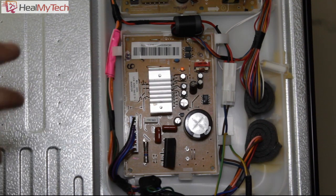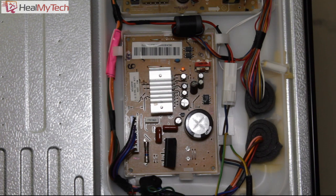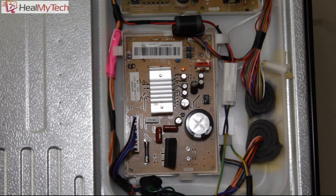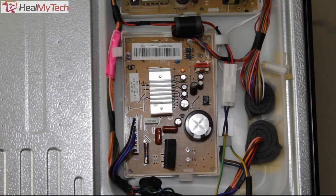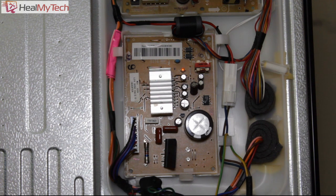The LED blinking means one of two things — either the sub-inverter board or the compressor. The reason we change the sub-inverter board first is because it's much simpler to change that than it is to reinstall the system. We'll switch it off and allow any residual supply to dissipate. This is an educated guess — it would be the first troubleshoot point.